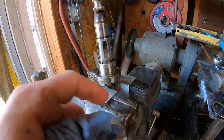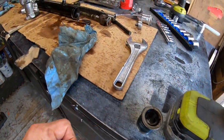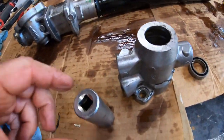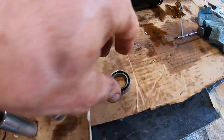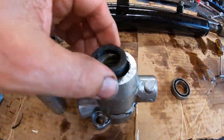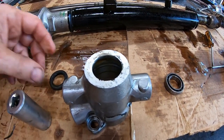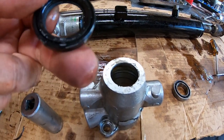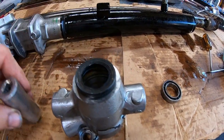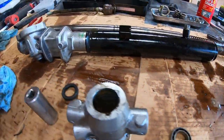I'm just going to clean that bearing and repack it, then finally put it back together without those extra parts. I got out the seal and the bearing — had to use my press. I used a socket that was the same size as the inside and pressed the seal and bearing right out. Now I'm officially 50% done.